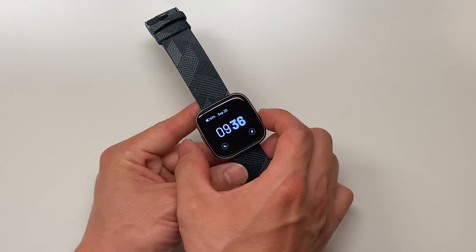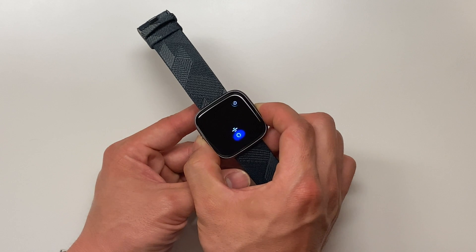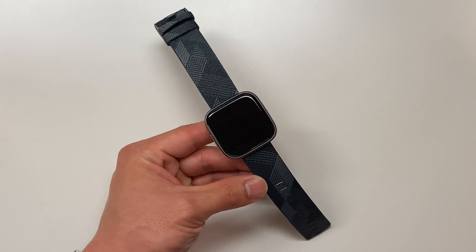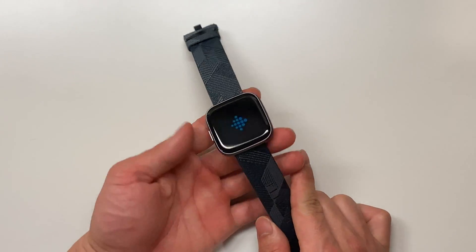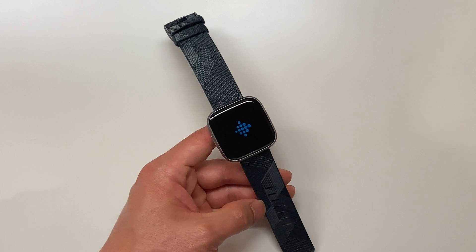You're just going to press and hold down the left button. Now it will bring up Alexa. We are just going to keep holding it until the screen turns off. We're going to release it and it will restart. This is a soft reset — it's good if the watch is frozen and unresponsive. You can hold down that button and it should trigger the watch to restart.